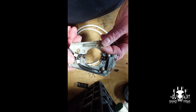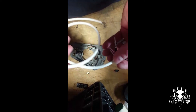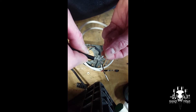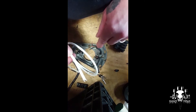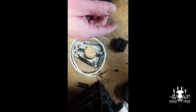There was heat shrink wrap from here to the old wires, so I just cut them off before the clip, then gently went in there and opened up one side of the clip with a knife and a set of pliers. The wire I've used has a wire braid jacket on the outside, and it connects to the pin area but not into the Hall Effect sensor itself. So it's there for some reason — I'm pretty sure it's to pick up electromagnetism or something of the sort. I'm not an electrician.